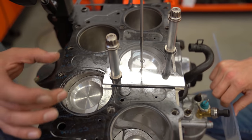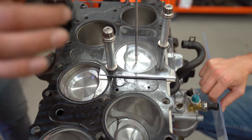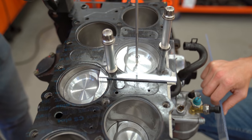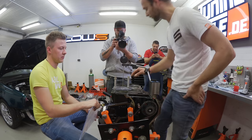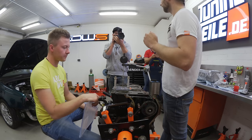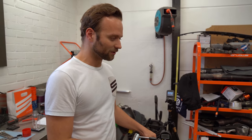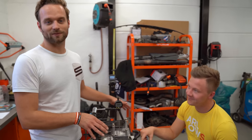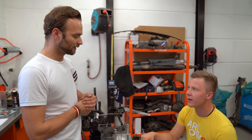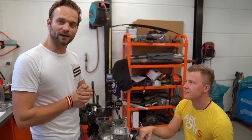So, what do we actually want to do? As you've heard in the last episodes, we installed shorter connecting rods - 3mm shorter - to run a thinner head gasket. We also shortened the intermediate plate at the same time. The whole thing should now have a compression ratio of approximately... well, the problem is we have no exact values, only what's roughly said on the internet. I'm hoping 8.5. We definitely need to determine this value.